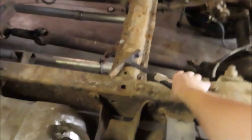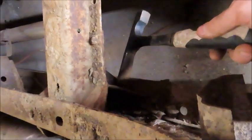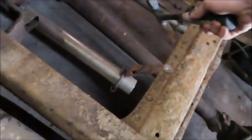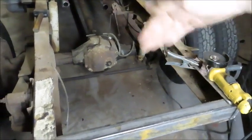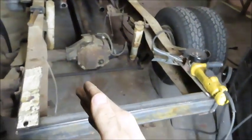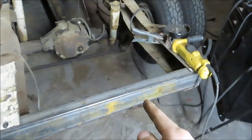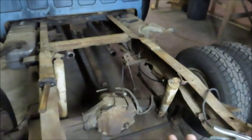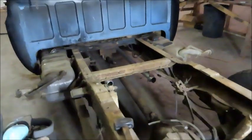The first thing I've got to do is remove this crossmember, because our inner four-link bracket will go exactly where this is, so this has to come out. This would have to come out anyways because of the driveline — when aired out it would be either really close or hitting this crossmember, so we'll have to build a custom one. Also, since we've already cut out the other crossmembers, the frame has potential to move out of square. So what I've done is tack-welded this piece in here for the time being with some really strong tacks, making sure they have good penetration so that whenever I cut this out the frame doesn't move side to side. But I will take measurements anyway just to make sure nothing moves and everything is perfect whenever we go to weld everything back up.